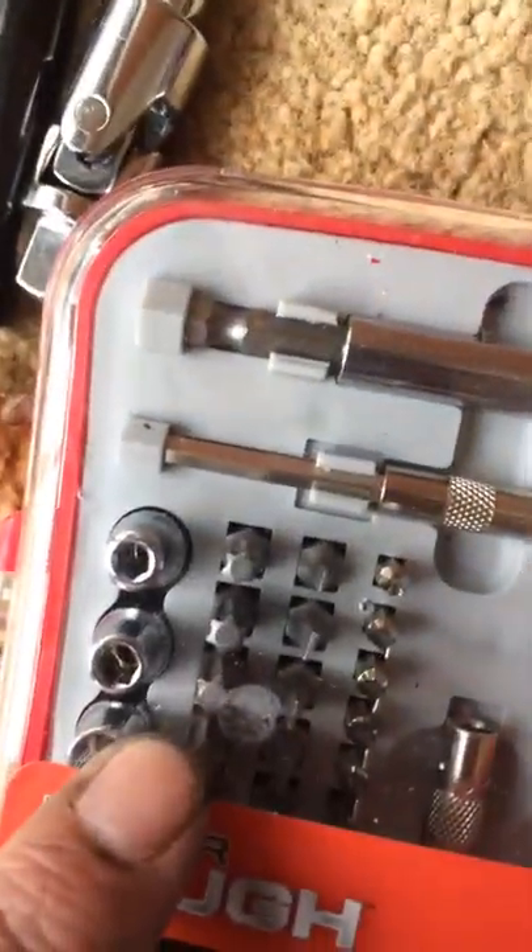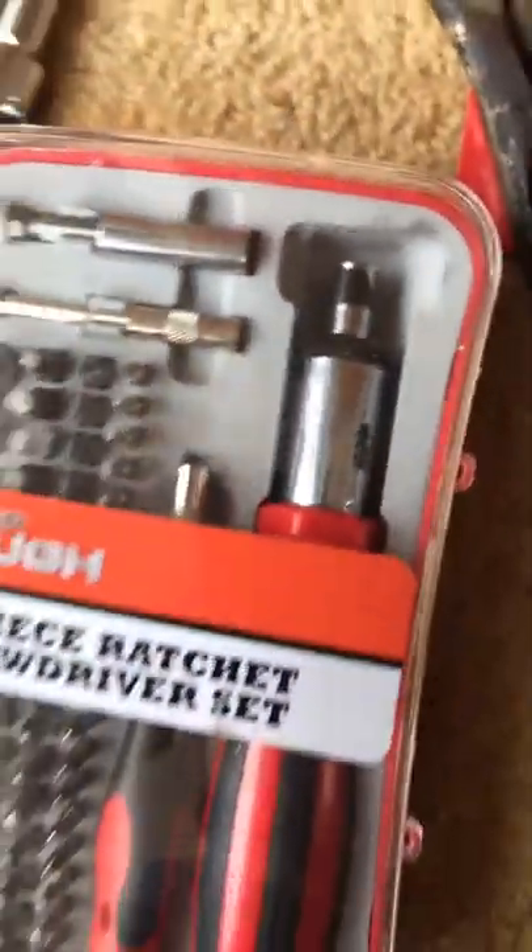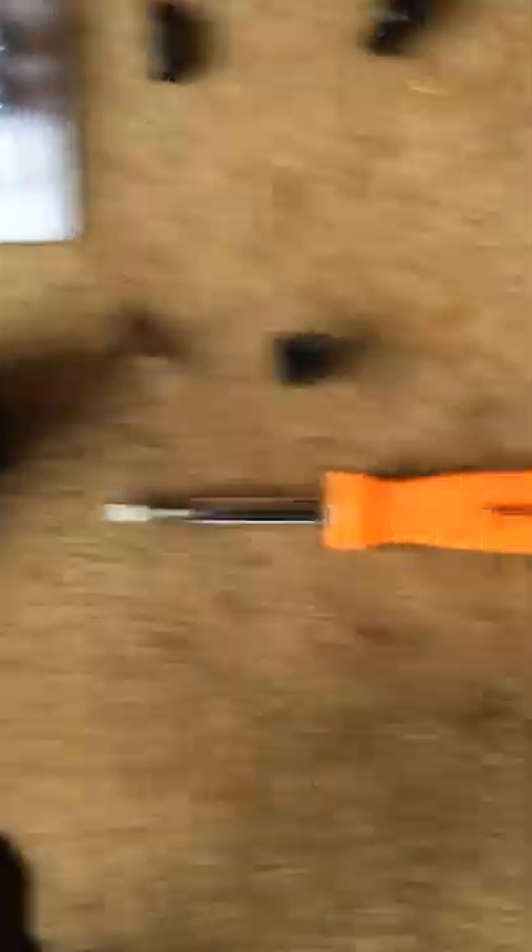If you like to work on your cars it's gonna take some time, and I just showed you a couple things — it's not a lot to take it out, it just takes time. Get yourself a long screwdriver, a couple of 6-inch extensions for a 3/8 drive. Nothing's really torqued on there hard. Get you some T-sockets — I went and bought a little kit, it's got all these little bits in it you need to get your bracket off the front. I'm gonna show you something — see this little tab? This is the way these hoses come off.